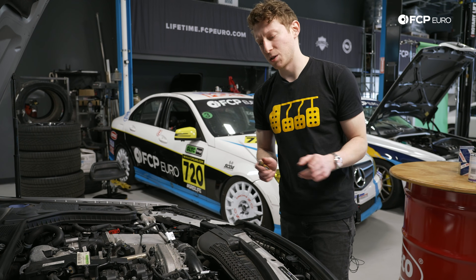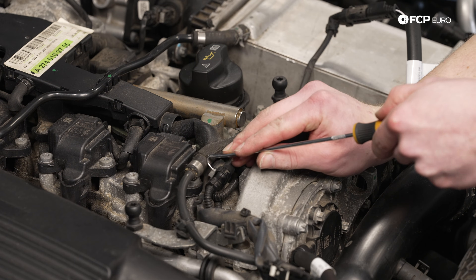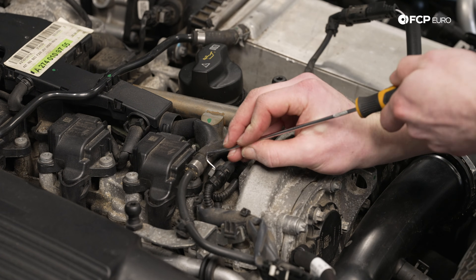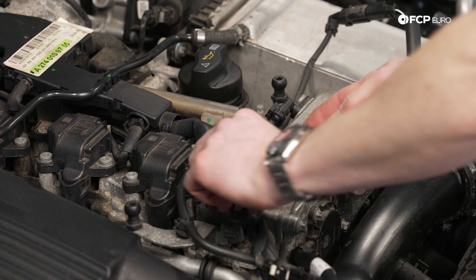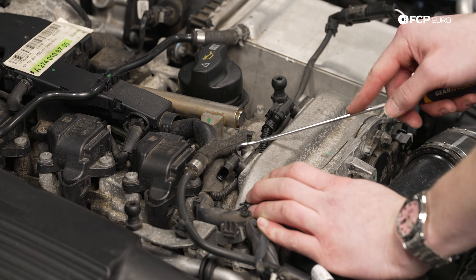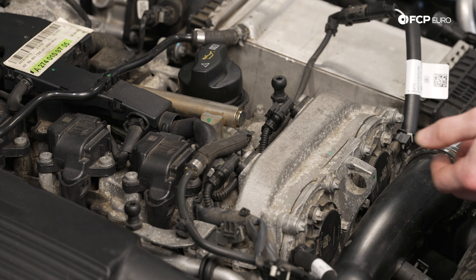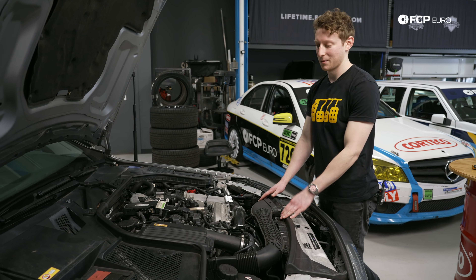Moving up from the cam magnets to the position sensors — in my experience these ones are probably going to fight you less, but still be gentle. Take your pick and coax the little gray connector up until it clicks; you may even be able to use your finger or a flathead screwdriver. Then take your pick, wiggle it in the nose, and gently coax the sensor off. Once you have it out, it's just the torx bolt up top — pop the new sensor in, torx bolt back down, plug in your new sensor. If you did have oil residue in there, blast it out with the electronic cleaner, then pop your gray fastener back down and you're done.